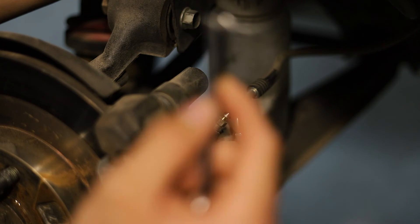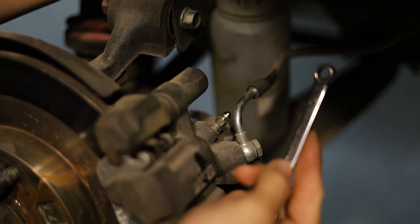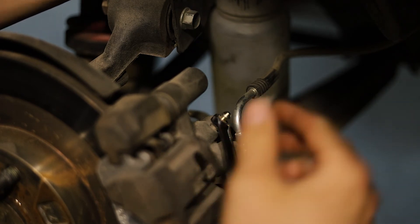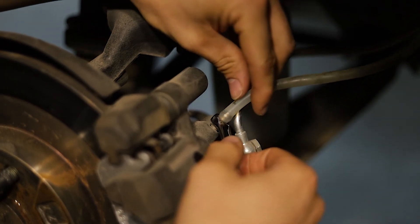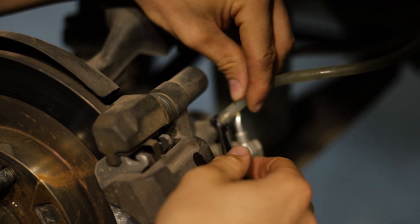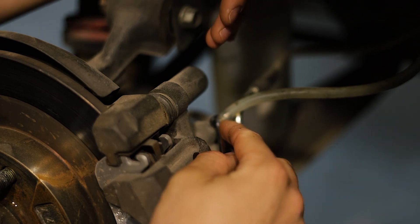We're here at our right rear caliper ready to bleed the brakes. If you haven't seen how brakes are bled before, here's a little informational. For this car, a number 8 wrench is all we need, plus a vinyl hose and a plastic bottle to expel the dirty brake fluid into. It's as simple as pumping the brakes up, releasing this nipple, and letting the fluid empty into the bottle. Eddie, pump up the brakes. Release the nipple, fluid goes out, tighten it up, and he can relax. We repeat this process over and over until we run a quarter of our new bottle through this caliper, then repeat it three more times on the other calipers. Really as simple as that.